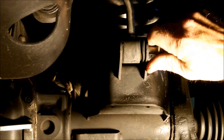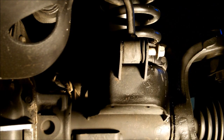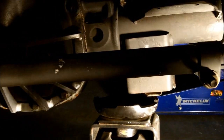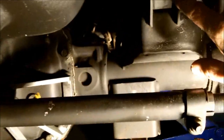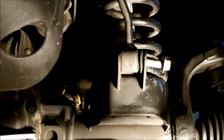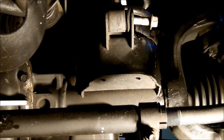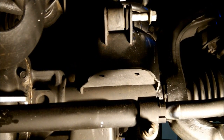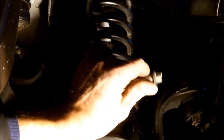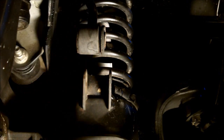I've just pulled the nut off on this side here. We've got the bolt right here. I'm just going to drive this bolt out. I've also supported the axle with another jack right here, just so it doesn't drop suddenly when we pull the sway bar bolt out. Lower it just a tiny bit. If you get this — raise the axle to the proper height — the bolt will pretty much come right out. We got that disconnected.